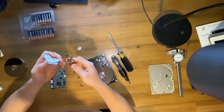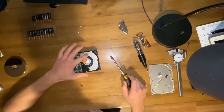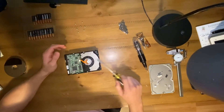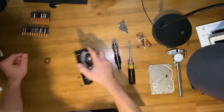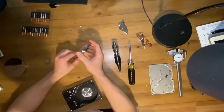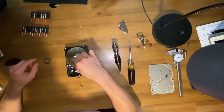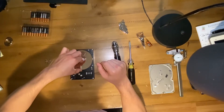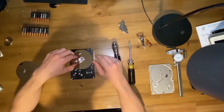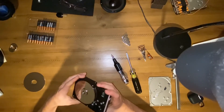We got those cool parts out. If your drive has a weighted plate right here, take it off. You have to remove those spacers and then put them back on with the other discs on — put as many on as you can. Make sure that the discs are pressed down nicely by the cap.